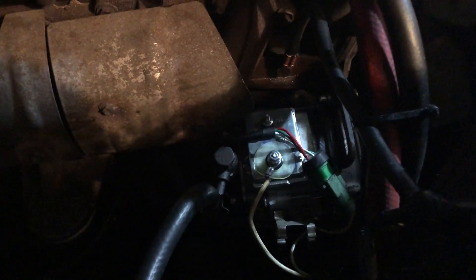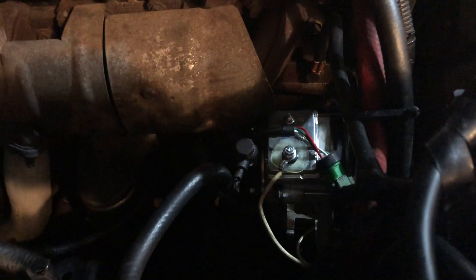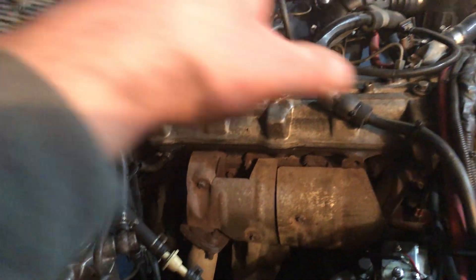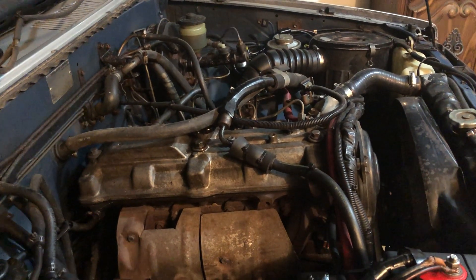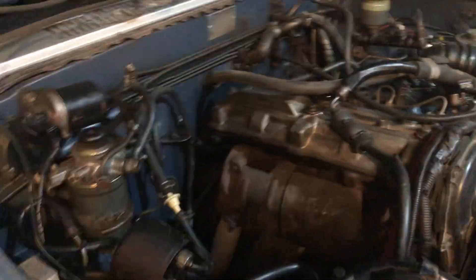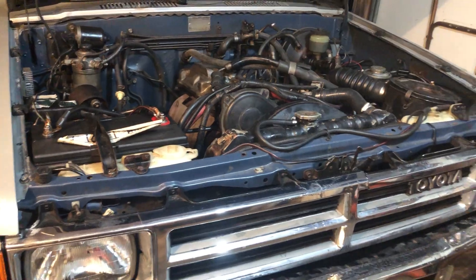So the alternator I just put on today — got the belts back on, got everything sorted, and it runs really well. Over the winter it lost its prime, so I had to pump it like a million times to get the diesel in. Didn't even have to crack the injectors, just pump, pump, pump until I felt pressure, turn it over a few times with the glow plugs and she fired right up — sounded like the tractor that she is. I'll go inside the truck and show you the starting procedure. We put the clutch in, we press the glow plug button — it's a manual little glow plug button because this is an engine swap — we press it for a little bit, turn the key, and she comes to life.